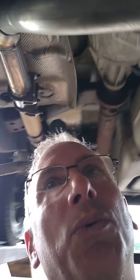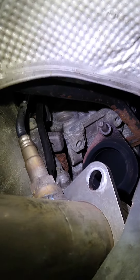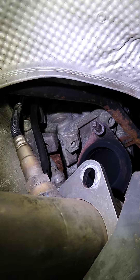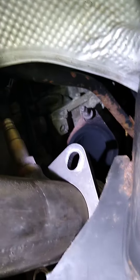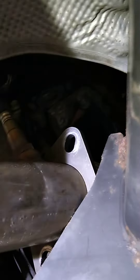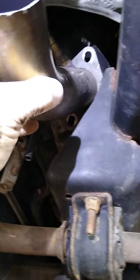What's up YouTube, so we're getting into why this direct fit exhaust system doesn't seal to the manifold. If you look at the factory bolts, they have a shoulder on it — you see the threads and then about an inch up it's like a washer shoulder. The washer shoulder can't pass through the flange, which makes you think the exhaust is tight against the manifold when it's not. The flange is stopping against the studs, keeping the pipe from going up.